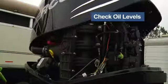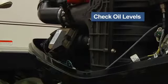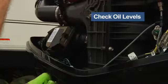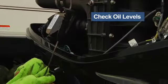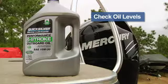Checking the oil can get a little tricky. You have to know what kind of engine you have before you can check it. If it's a four-stroke, it'll say so on the cowling. A four-stroke must be checked by removing the cowling and pulling the dipstick, just as you would on your car. Be sure you use an oil that's approved for four-stroke engines.